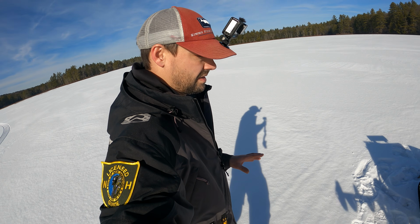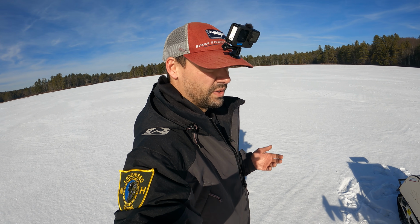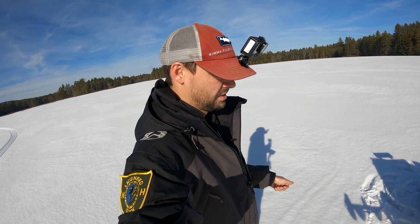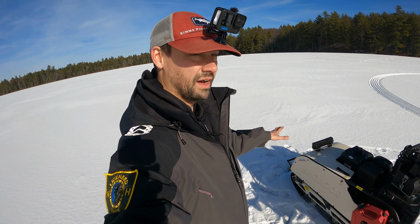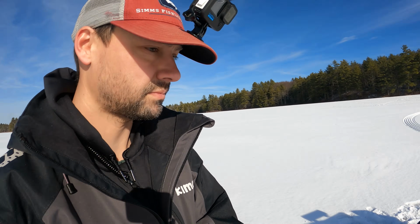So that's a big issue. I don't know how they would fix that. Maybe a dual return cable, like where you have a twist throttle or something like that, where it's push and pull at the same time, not just a pull. So you can crank that thing off or somehow shield the governor from getting snow in there. They do a good job with the cowling and stuff like that, but that still happened to me.